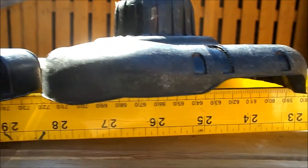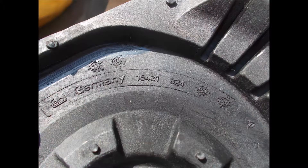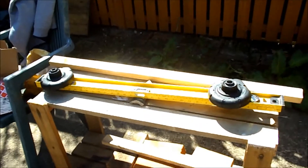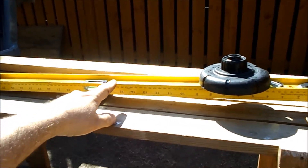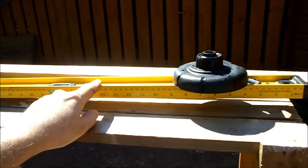There is talk of some other one Volvo supposedly make for the XC90 all-wheel drive cars, but I could not find any information anywhere on this, and no dimensions or mass details, so it is mythical as far as I am concerned — impossible to distinguish on the internet from any other spring seat mount. There are lots of the weedy looking ones that weigh 581 grams or less, floating around at 12 British pounds a shot. The IPD ones are nearly 4 times that price. I still have no long-term report back on how long they last, but given a lot of stuff on replacing this OEM flimsy part is 4 to 8 years old online, that there is no news is probably good news.